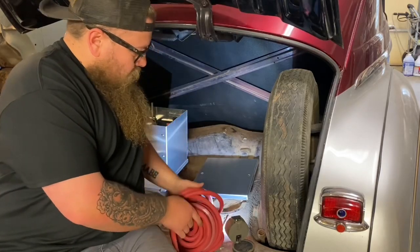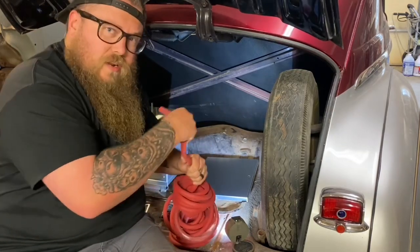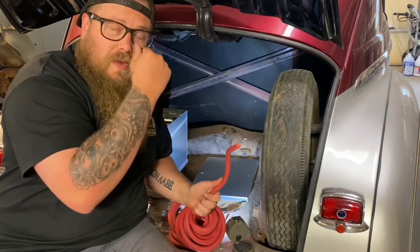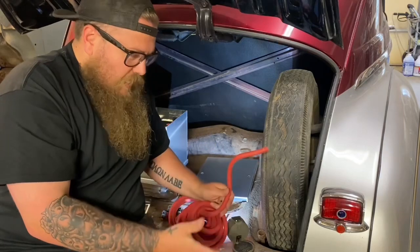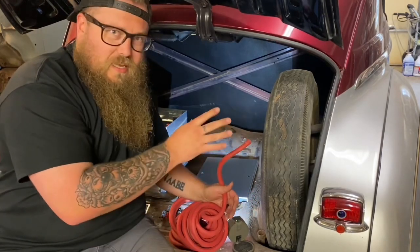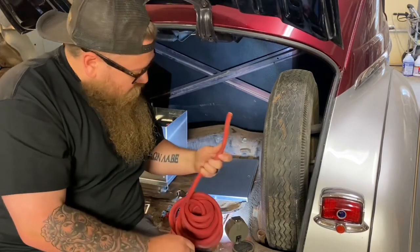There's a mathematical equation for how thick your wire needs to be based on amps and length, but I'll save you the hassle — I usually use 1/0 or 2/0 cable. 1/0 is standard for a car; 2/0 is bigger and is more for setups with air compressors, big radios, or subwoofers in the back. This is a small block Chevy with hardly anything electrical, so 1/0 is going to be just fine for both the power and the negative.